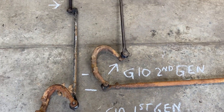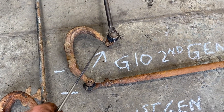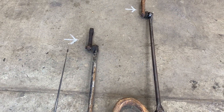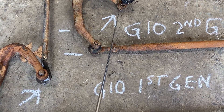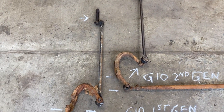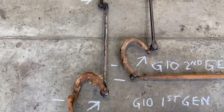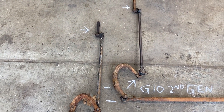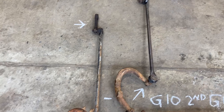The difference between the first and second gen also means that these drag links are not interchangeable, since they both point outboard when they go into the pitman arm, but at the other end one faces down and the other one faces up. Now some people have made custom drag links that are threaded on both ends, similar to this tie rod, and that way they can adjust their steering wheel. In that case you could interchange the drag links, but with these fixed drag links they are not interchangeable first to second gen.